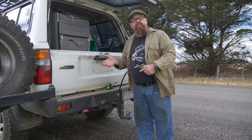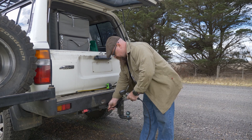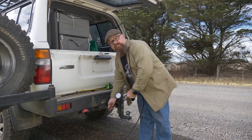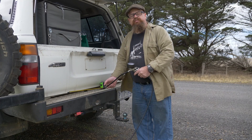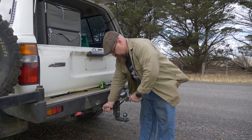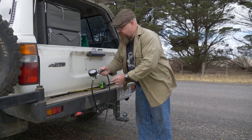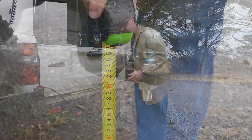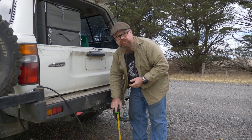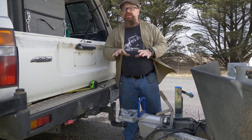The maximum inflation pressure is 30 psi for the bags, so we'll start with 20 psi and see how that works for us. It doesn't take long to pump them up because they're only small volume. We've got one bag up to 20 psi — let's do the other one. Now we've got both up to 20 psi. Let's check out the height difference — and as you can see, it hasn't changed; it's about 410 mil. So the tow ball height didn't change with the air pressure in the bags.